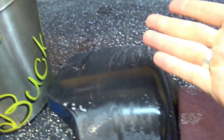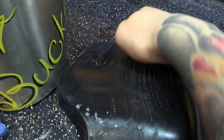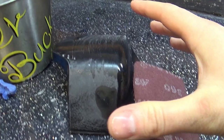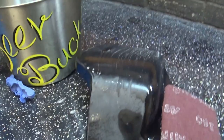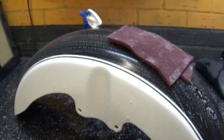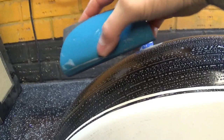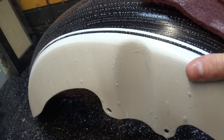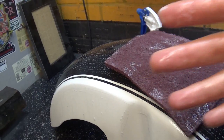So when the clear coat goes on top, it won't be so visible. If you go all over the place — one way and the other — you can still spot scratches underneath, and the clear coat adheres differently. But if you dress everything one direction after sanding, it creates a uniform surface, and that's important because the flow coat goes on top of it. Very rarely do I need to polish after that — the flow coat will most likely look good as-is, no orange peel. I've done the hard work with sandpaper and a soft block in a cross pattern, then gone back with the red scotch brite on hard-to-reach places, dressing everything so the flow coat looks better.